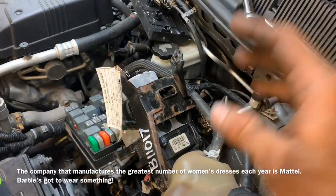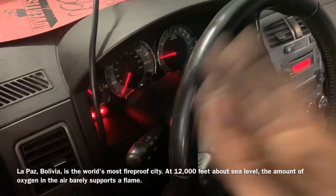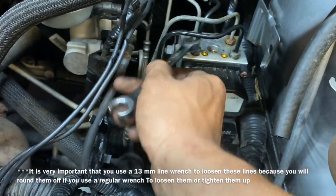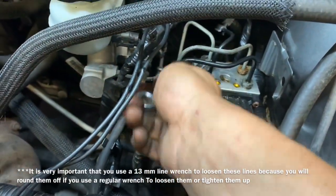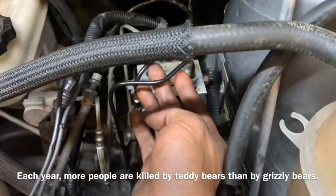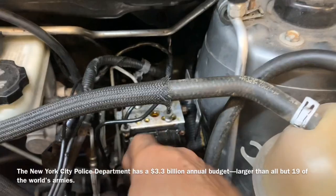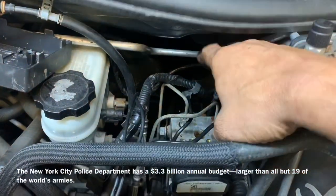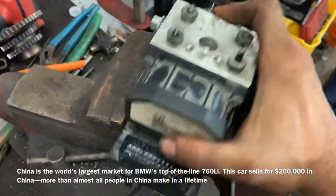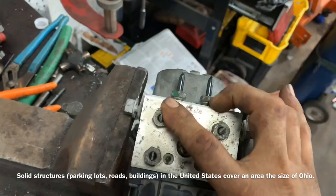Because the brake lines are really a pain to change, I plugged everything back in — my battery, my fuse box, all that stuff — and plugged my new controller in. I started my vehicle to verify that I had no more ABS lights on. Because there are six of these brake lines, you want to be extremely careful when you go to remove these. Do not move them any more than they allow and do not bend the lines at all, or you will have serious cursing matches in the garage when reinstalling. Moving them as little as possible is definitely recommended. The pump sits in the bracket with a little rubber pin that goes through there, so it slides up.